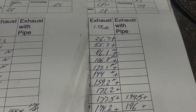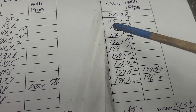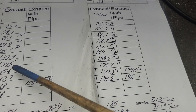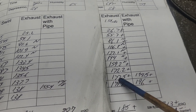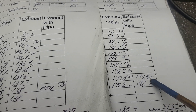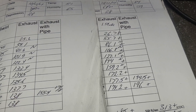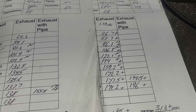Our exhaust numbers — that's where we were stock, and this is what we got. We got all pluses. We had three spots of noise; we still have three spots of noise, but we got a boost everywhere. After 0.35, this one is pretty much done already, but we keep gaining. 177.5 — not great, but not bad for only a first cut. And you put a pipe on it: 194.5, 196 — right in this area is where our lift is going to be, so that works out pretty well. And remember, that's got no texture work on it at all — that is a burr short side, a light burr short side.